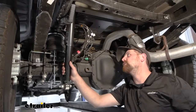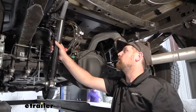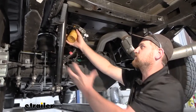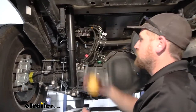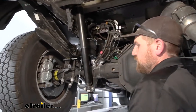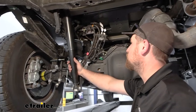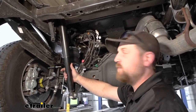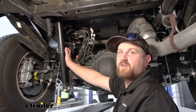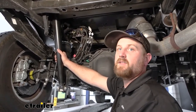Compared to some other suspension enhancements, it really depends on what you're trying to do. There are others similar to jounce bumpers but a lot bigger, beefier, and progressive — meaning they get stiffer as the load increases — and those just bolt right up and replace the jounce bumpers. I like them, but it depends on what you're going to be doing. If you tow occasionally, those might be better because there's no maintenance, but the downside is they're not adjustable. Having an airbag lets you fine tune everything to your particular liking.